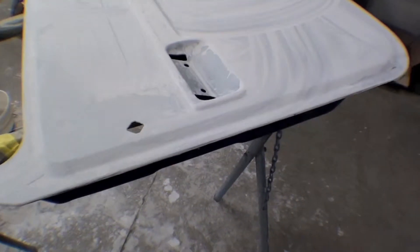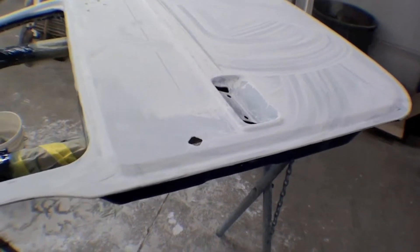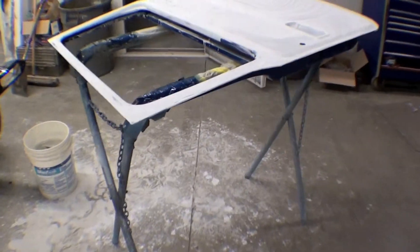We'll get this into final paint very shortly. This is the passenger side door. We're also going to be starting in on the driver's door — this is yet to be wet sanded. You can see a very slight type of a spray bomb on there. When that's all gone, that means we've gone down through just a small layer in the middle of the thickness of the primer, so we're not going to eat into any other portions of the bodywork that has been done.